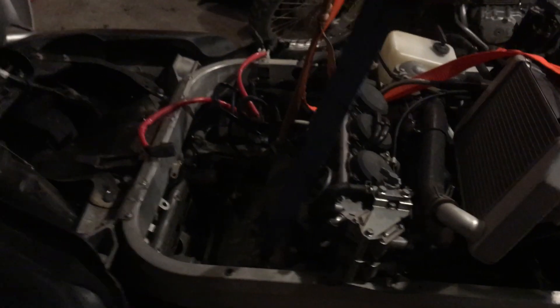We removed the two side plastic shrouds and the plate underneath the engine that houses access for the oil filter — that's where the starter has to come down. So we took the filter off, drained the oil. Now we got the starter put back on. It's probably about a two to three hour job if you take your time.